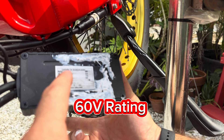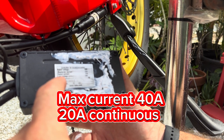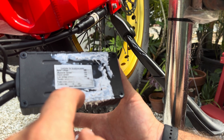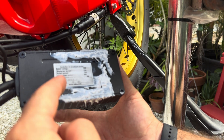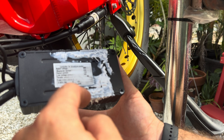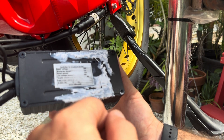So: 60 volt rated, max current 40, rated current 20 amp continuous, low voltage protection is 50. Throttle adjustment looks like 1.2 to 4.4. LSW 2043-53 is the product number, manufactured in October of 2024.